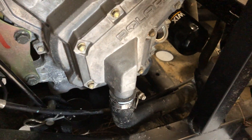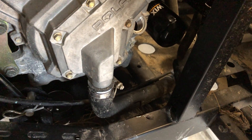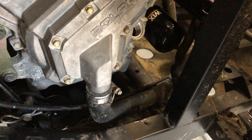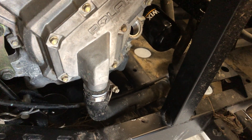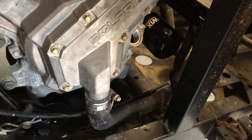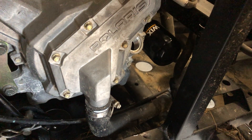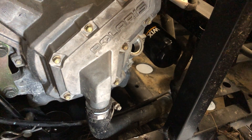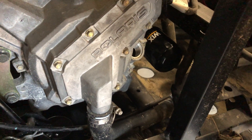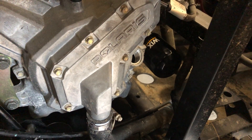This keeps you from having to clean up your skid plate — you can see there's always mud and everything packed up in there, and it's a pain to clean up once you get oil on it. Once your old filter is off, toss it. Take your new filter of choice and lubricate the o-ring with some of your new engine oil. Dip your finger in the oil and run it around, making sure there's a coating on it.